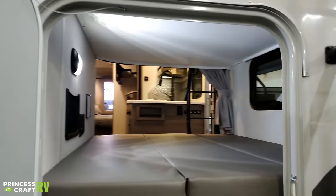Beside this, we have kind of an external TV area. On the inside, we'll find a secondary TV mount that mounts here. You have multiple power sources: a 12-volt cigarette-style receptacle, a couple of USBs, and a couple of 110-volt all-weather outlets. The potable water fill is here — this is the onboard holding tank for water. We're going to stick a garden hose directly in here, fill it up until it overflows, then cap it off. We then use the onboard water pump to pressurize that system and draw it up to the fixtures to make it usable.